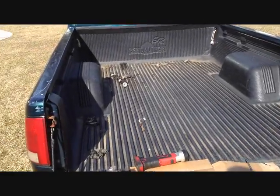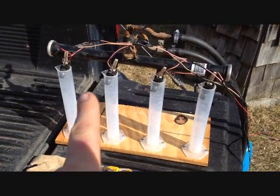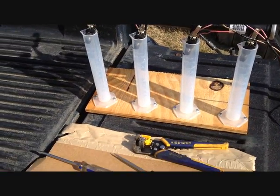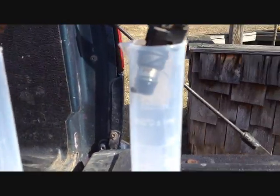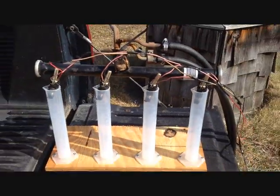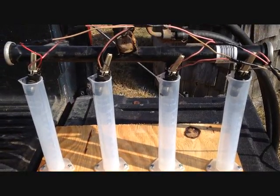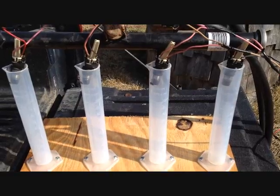So far I've found four fuel injectors that are absolutely garbage. I swapped out the last one and we're going to try this again. Those three right there leak when they have pressure put to them but aren't being pulsed. I'm going to turn the fuel pump on — there's one that's leaking right there, so they're failing the pressure check. I'm going to have to change my dynamic settings a little bit on the Arduino because it's not flowing that much. I'll do the static first and show you guys how much static flow they are across all four, then I'll do a dynamic test.